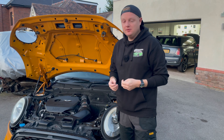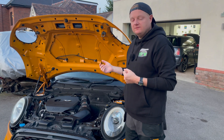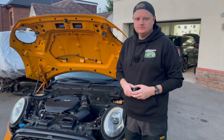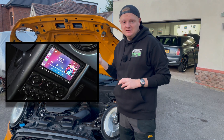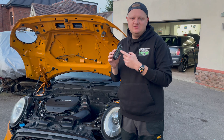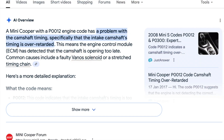Hey everyone and welcome to today's video. If like me you find yourself messing with cars, especially with a lot of the DIY jobs, cars are just getting more and more complicated. You're going to come up against error codes and different things with the computers that you just didn't have in cars historically. One of the most useful things I've used in recent years is a scan gauge - it connects to your OBD port and reads temperatures, engine management codes, giving you things like a P0012 type code which you can look up on Google.